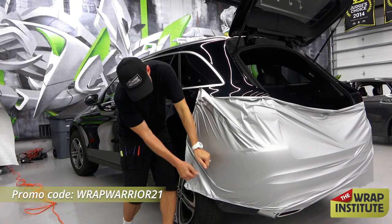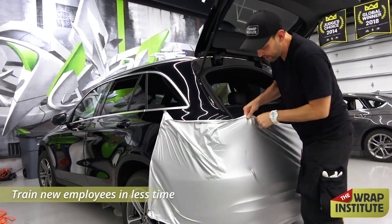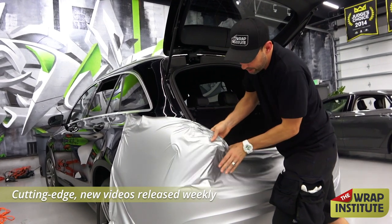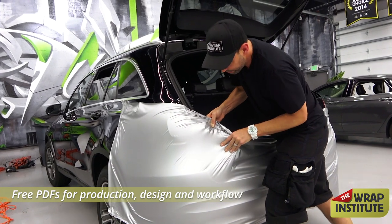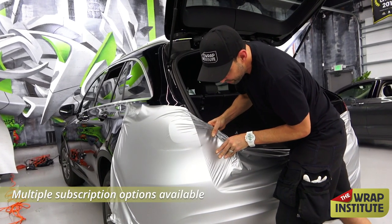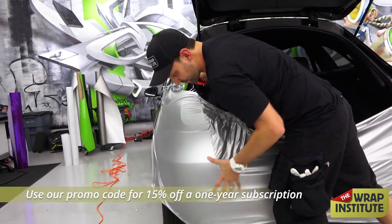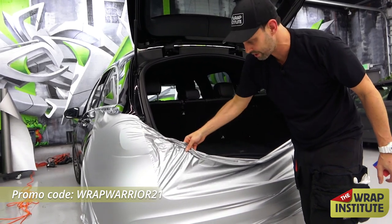More material bunches up here. I come down and scoop this corner, but instead of pulling this way I pull that way — huge wrinkles, but that's not a bad thing. I pick the material up, give it a little shimmy, and pull quite hard into this area. I take it back, give a little shimmy, then pull very aggressively, locking it in on the high side and squeegeeing right to here — no adhesive lines. All those wrinkles from the corners circle back right here. I lock it on the ridge and look how hungry this was — now it's fed. That's the entree.